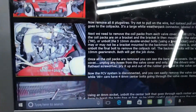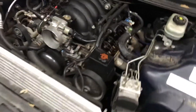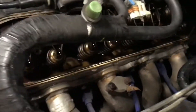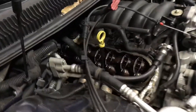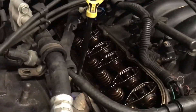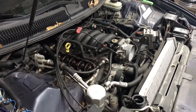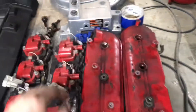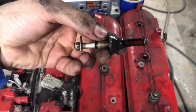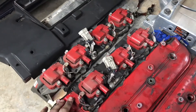I can take the coil packs off — I'll keep updating you guys. I've got an LS1 how-to pulled up here, so I'm just reading this step-by-step. Quick update: just got both valve covers off. There's the rockers and springs — pretty easy to do. Making good progress, it's only been about an hour, hour and a half. Here's the valve covers and coil packs — it's just eight millimeter bolts on these weird-looking things. The coil packs are ten millimeter bolts, I think five of them, then four on here.